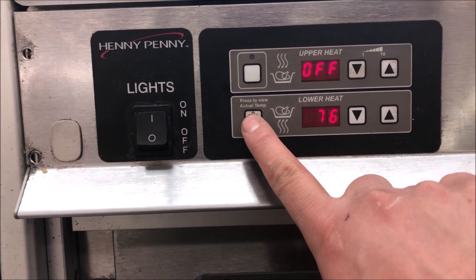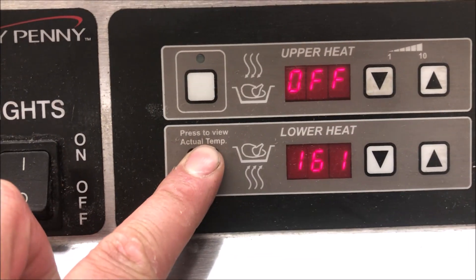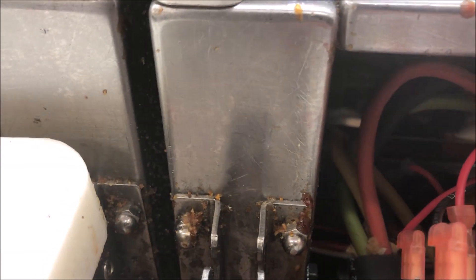We've got the new board in. We're going to set our set temp for the lower heat and for the upper radiant heater, then clamp on to make sure all three elements are pulling. First one: 3 amps. Second one: 3 amps. This last one that's piggyback — we're going to see 6.2 to 6.3 amps on it. All good. Now I want to cycle it off and make sure we're shutting off. We're one degree away from set point. Now we're at set point, pulsing — which is fine. Once we go a little hotter, it's going to stop pulsing on that element: 3 amps, 0 amps, 3 amps, 0 amps. We've stopped pulsing — 0 amps on the middle element, 0 amps on the far right, and 0 amps on the last one. We're shutting off as we should be.